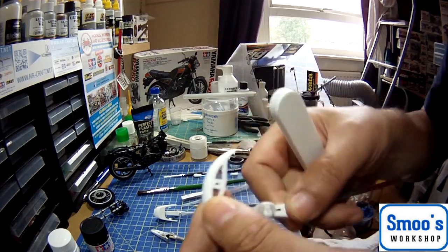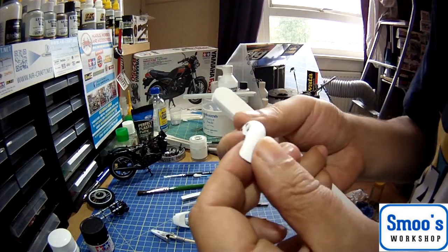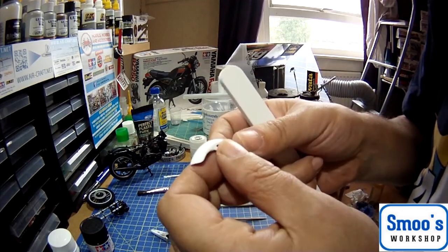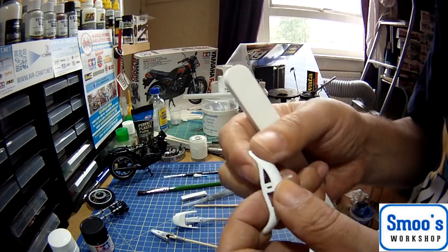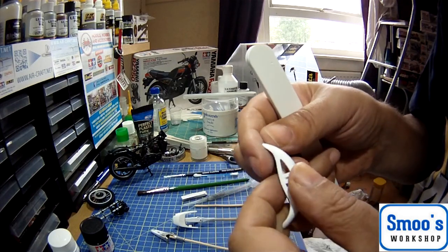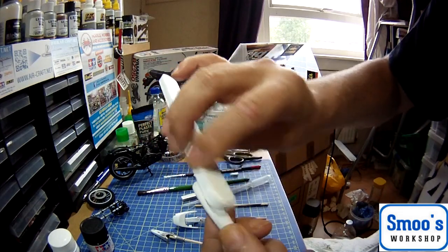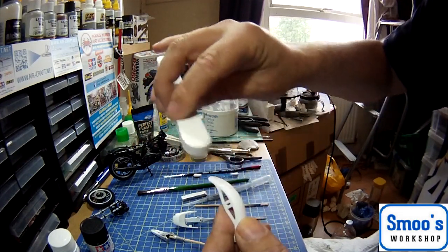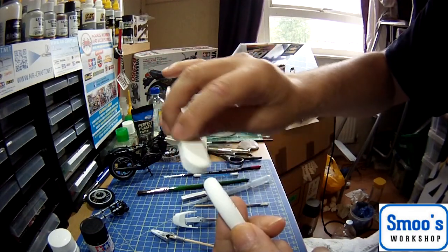If this mudguard comes up alright, I'm going to chance it with the tiny wee blemish that's on this and go with top coat. Now, the bit I was looking at, although it all looks reasonably smooth, there was a bit of paint build up that I didn't quite get before, so I'm just gently going over with the buffer. As I say, it's really fine grade.